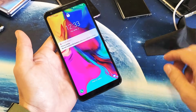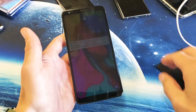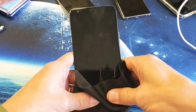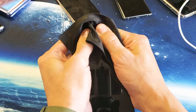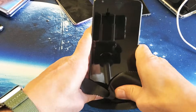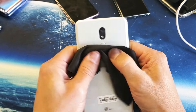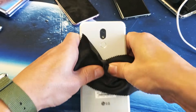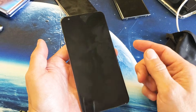If not, we'll go to the next step. So you still have the black screen. I call this the massage method. I want you to press on your screen and on the back. You can use a paper towel, a cloth, or your bare hands. Start massaging the phone kind of hard, because a lot of times there's a minor loose connection in the back and this can easily pop it back on. Massage the front all over, then turn it over and do the same thing on the back — press all over, even around the camera lens. Then do a force restart: volume down, power button, press and hold both buttons, wait for the LG logo, then let go. Hopefully you guys are up and running.